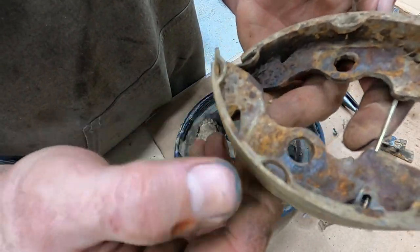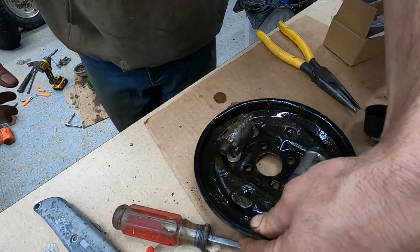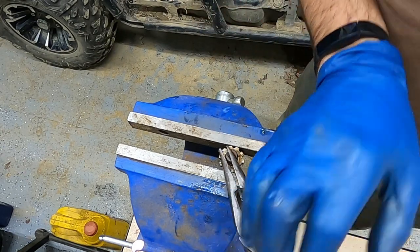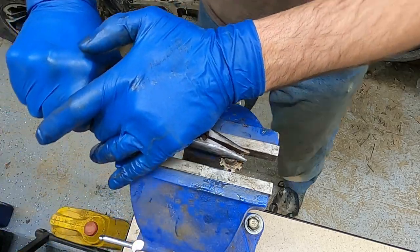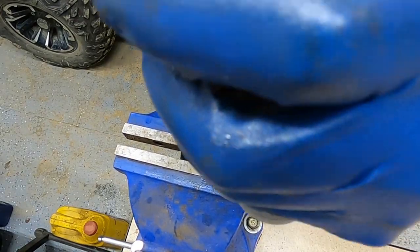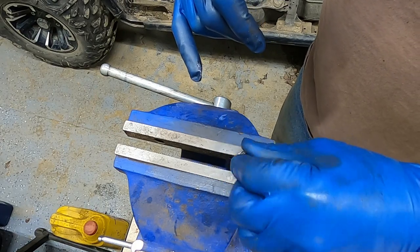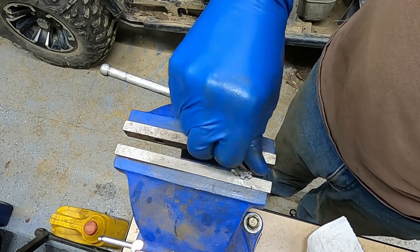Not much life left on these guys - this one's down to bare, this one has a little tiny bit. I'm going to hit this with some brake clean. That's looking better. Both adjustments on both front brakes were completely seized up, and it took quite a lot of effort to get them freed up. As I suspected, they were completely rusted, hence the seizing up. I took the old wire wheel to the threads and cleaned them up real good, nice and shiny. Then applied a liberal amount of grease, and after that I was able to turn them right back in freehand. I did that to both sides and they're good to go now - good as new.